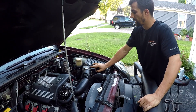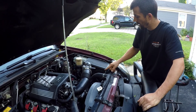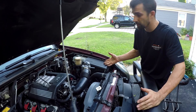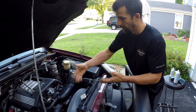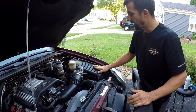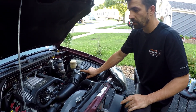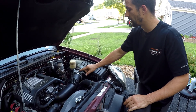If you want to clean your mass air flow sensor — like if you had a very dirty air filter or a performance filter and you pulled the car and had some dirt going into your engine — then you want to clean your mass air flow sensor. But you have to buy special cleaning spray for the mass air flow sensor so you don't damage the element inside, the hot wire.